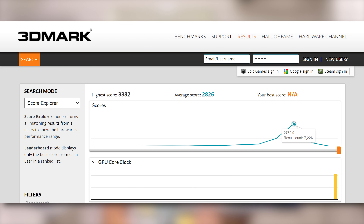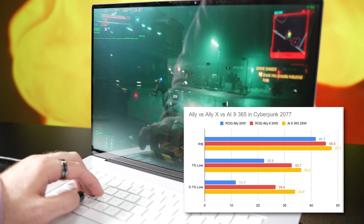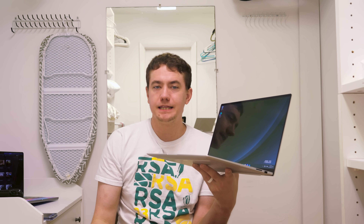We're hoping those are a bit more cost effective since you won't be spending as much on the accoutrements that ASUS provides in this laptop. Looking at the 3DMark results database, the ROG Ally equipped with the 780M iGPU gets a Time Spy graphics score of about 2750, whereas this 880M was able to reach a score of 3126. I also ran the built-in benchmark in Cyberpunk 2077 and got around the same difference, averaging around a 10% increase — ignoring the memory-limited original Ally stutters. So it's fair to say the 880M will average about 10% to 15% over any device using the 780M at around 28 to 30 watts.